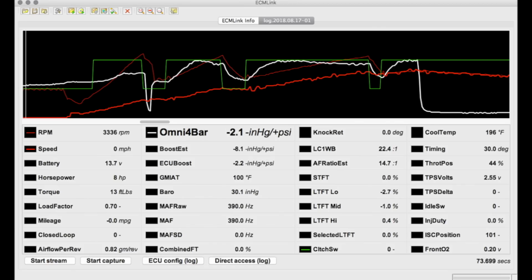I left the hole at half throttle off the launch limiter with pretty much no boost, and I still spun the right front wheel. As soon as the clutch engaged, I hit 1 psi and I spun it. At 1 psi, it's now established law that I cannot build any boost at all on or off the launch limiter from a stop with this car.